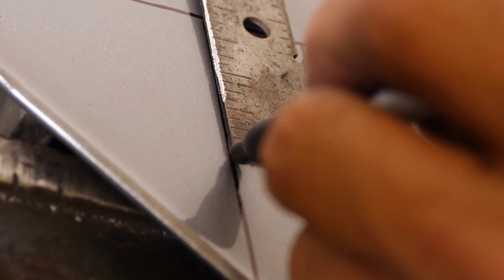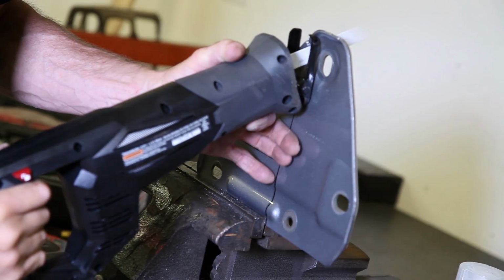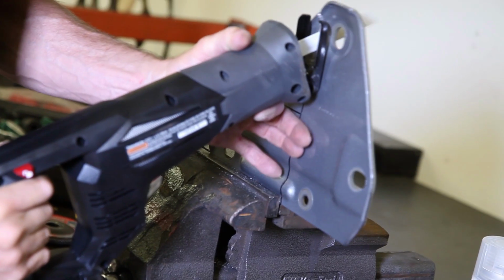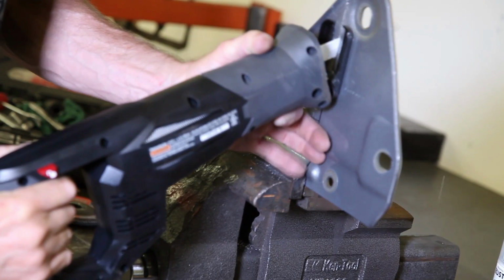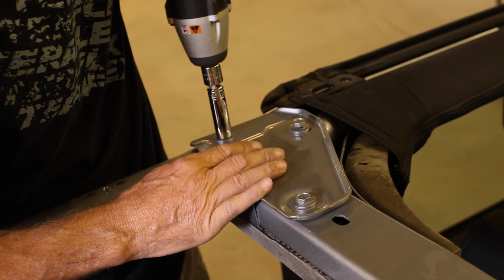If you have a satellite radio antenna, we can retain the original antenna mount by modifying how we trim the bracket. Mark the bracket and cut around the 2 antenna mounting holes, just leaving enough bracket to support the antenna module. Now if you don't want to deal with the whole bracket cutting thing, just tuck the module up inside the cover. It'll hold it just fine.